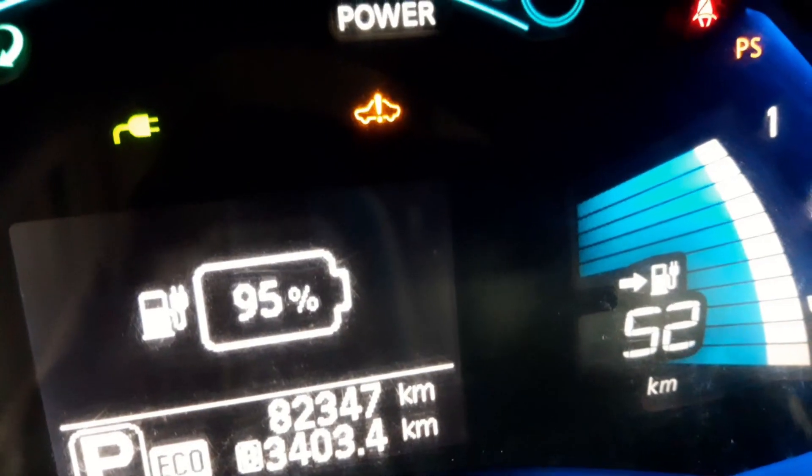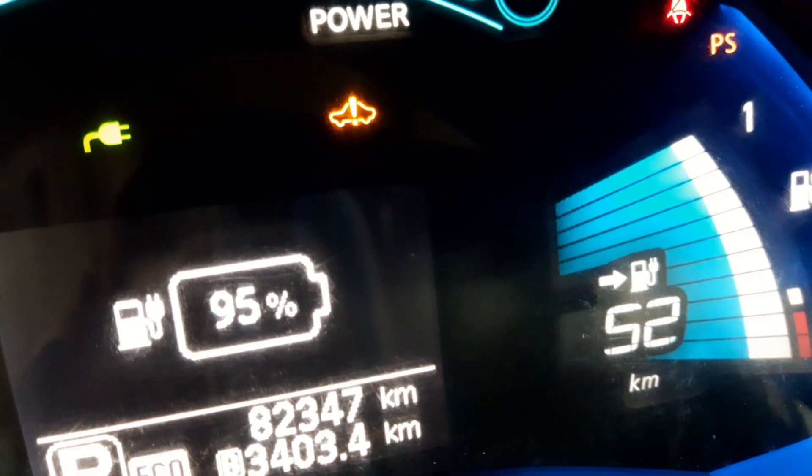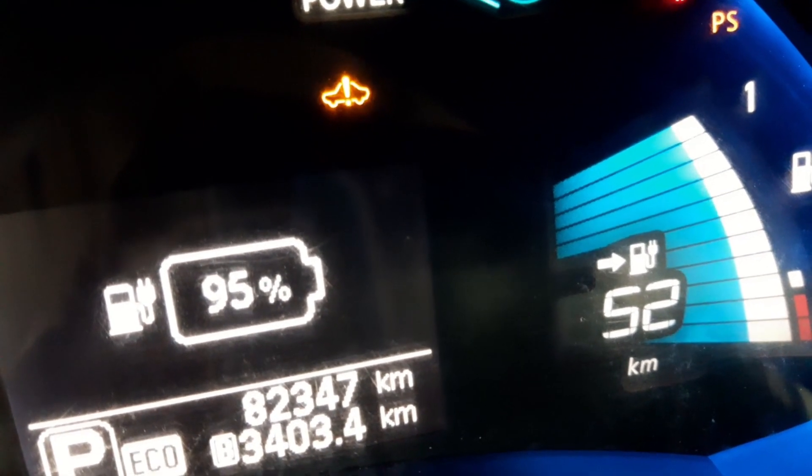So the car has charged up to 95% and 52 kilometers. Solar panels provided only 0.5 kilowatt hours for the one and a half hours of charging. That will give you only about 4 kilometers of range for your Leaf car. So that concludes that the solar panel itself will not help in significantly improving your Leaf range. However, you can have a battery backup such as mine, so that at some point in your journey you can stop your car and charge it with that battery backup to extend your range.